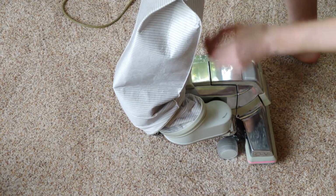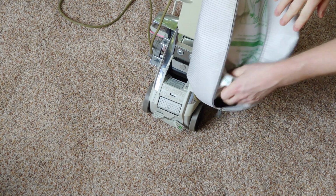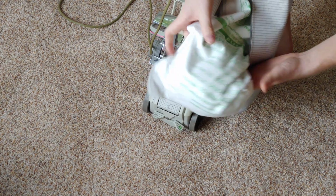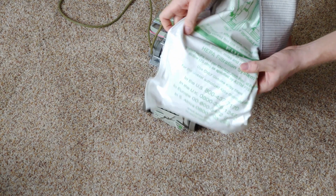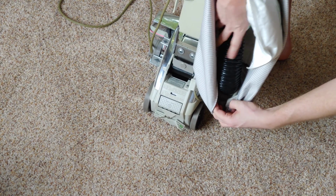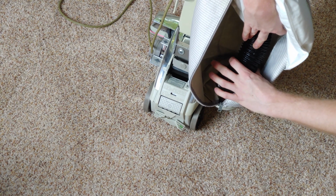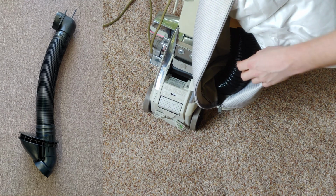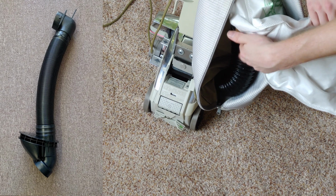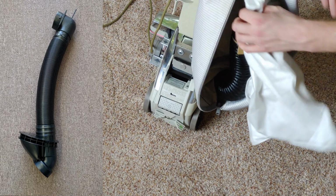Going to the bag change, I wanted to show you kind of what I've been vacuuming. I really have liked using this. It's got a certain charm on it. It matches my house. You can see I've put a bit of stuff into this modern high-flow HEPA bag. Now, of course, the G3 also had this older style fill tube that was not crush-proof. This corrugated fill tube is really, really thin and has a tendency to get holes in it. If you have one of these, you should change this out probably every 4, 5, 6 years. That needs to be changed out.